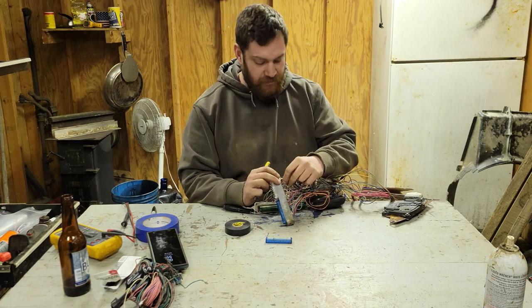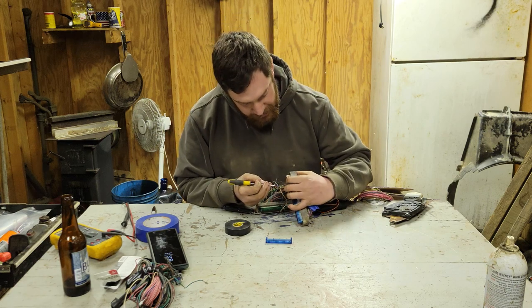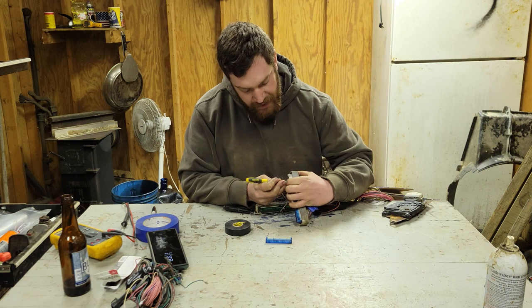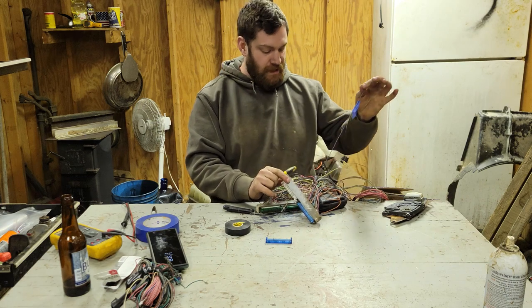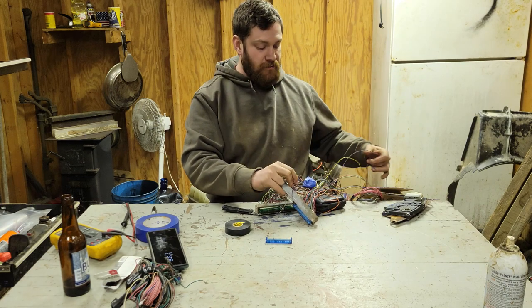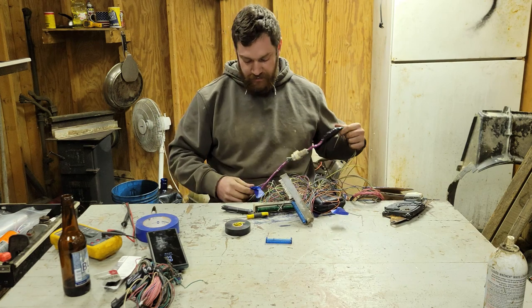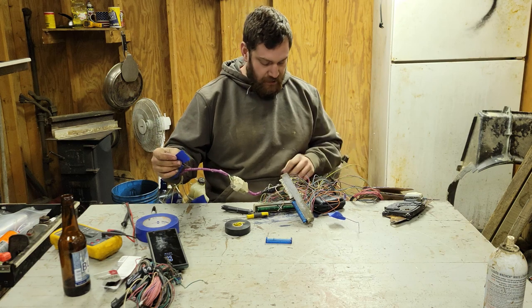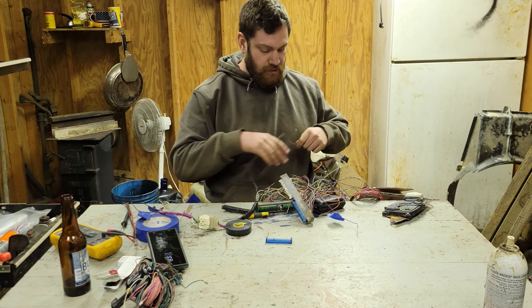It's my torque converter release. I'm going to shove that forward. I'm going to pull this little tab back while I shove down. And ooh, boom, that came straight out. This should go over to the fuse block. I won't need it anymore. Then I'm going to go over here and find the one that I have for my torque converter brake switch. Purple over here. Purple and white here. You can come here.